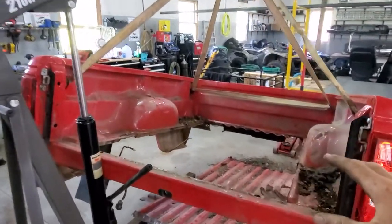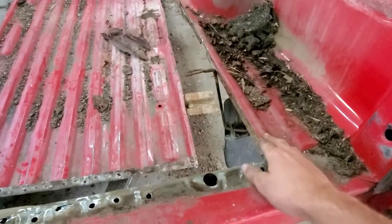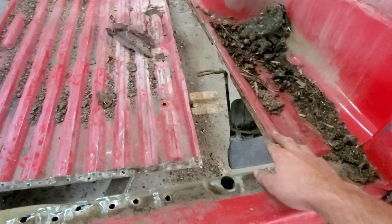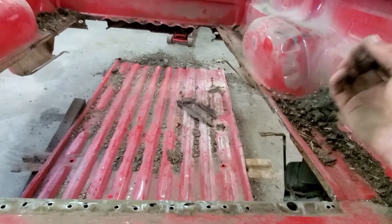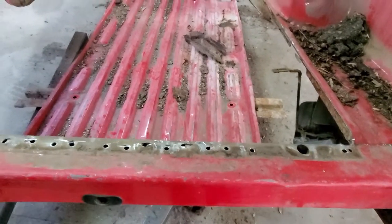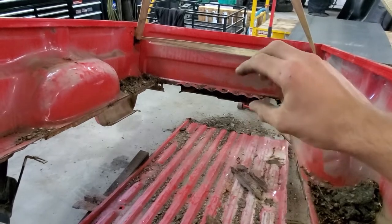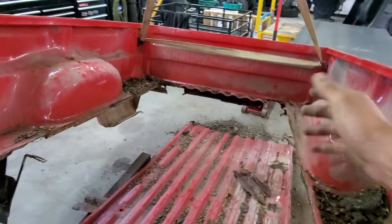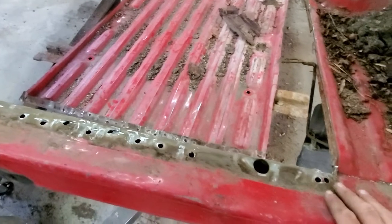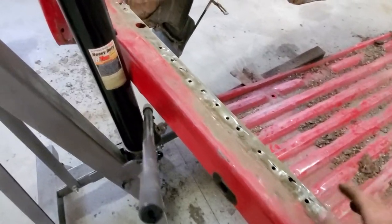This is now what the Ranger bed looks like. I've cut out the middle piece by cutting down the seam. There is a flange that's kind of bent over that merges the bed sides and the bed deck together via spot welds — you can drill those out just like I drilled out the spot welds in the back. However, I just chose to cut them. I've got to fix up the middle section because it sits on a middle crossmember. Back here I did drill out the spot welds — there were quite a few; you just have to feel them, brush off the paint a little, and you'll find them.